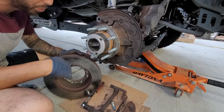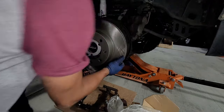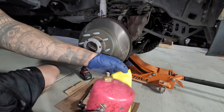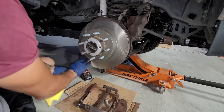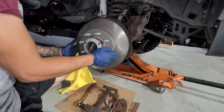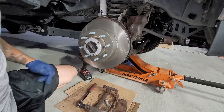Now we are ready to reverse the order with extra grease. So we're going to go ahead and put in our rotor. I would recommend doing this off the vehicle if you can. What I would recommend: spray a little rag and then just wipe down your rotor — front and back side. Just put the rag right here and spin it. This is just to wipe down any grease or dirt.